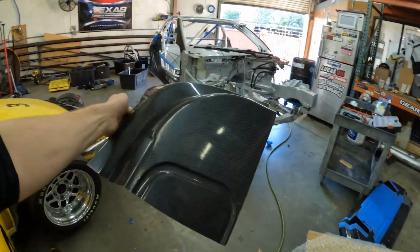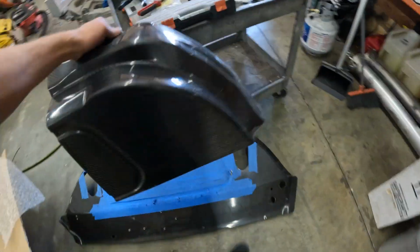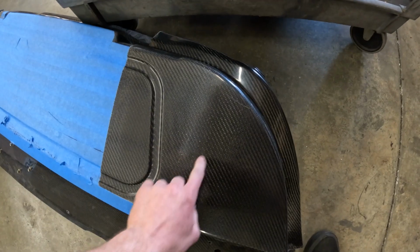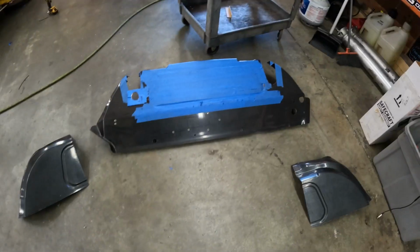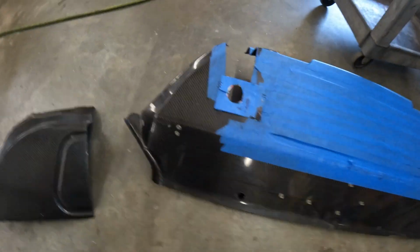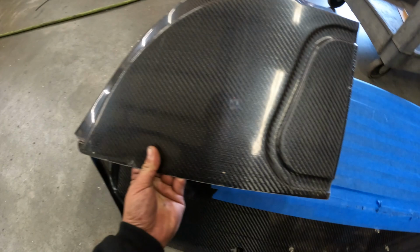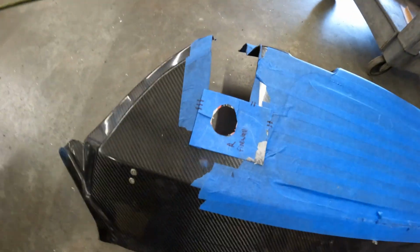Yes. These corners right here, because what you do, if you get these corners, put them up on the inside, mark exactly where your tube is going to go through, and then you cut it and then you mount it. It makes life way, way better mounting this. So here's sort of how this is going to work. Like Matt said, these caps go over the corners and then we have to put a hole in there for where the down bars go for the cage.